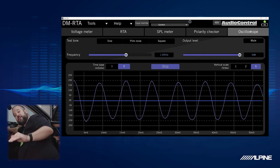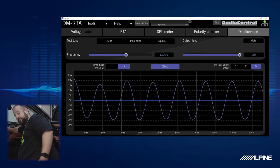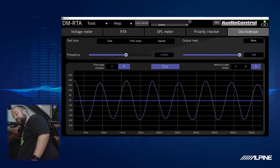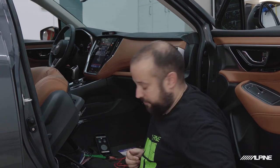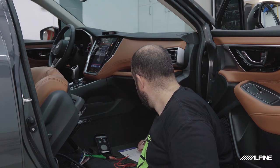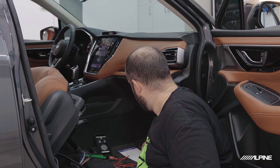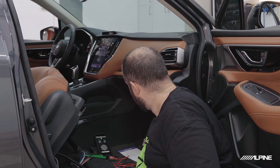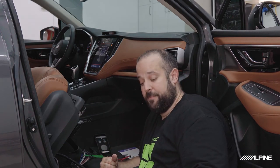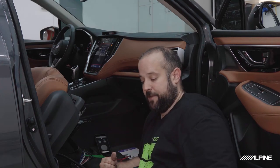And we also did notice that it did not square wave. There's something in this amplifier that is just allowing it to not do that. So that's cool. We actually don't have to worry about it. But we also want to make sure that we're getting the cleanest signal out of this that we can. All right, so we're going to notate that volume 32 is the maximum. No clipping. Now, if you do find clipping, that's when it'll square off on the top and bottom. If that happens, then back down one click on the volume, and that will be your maximum, okay?